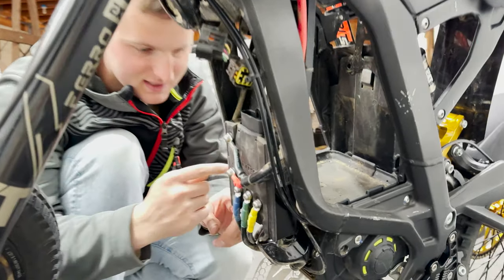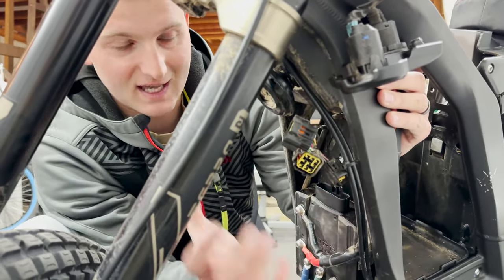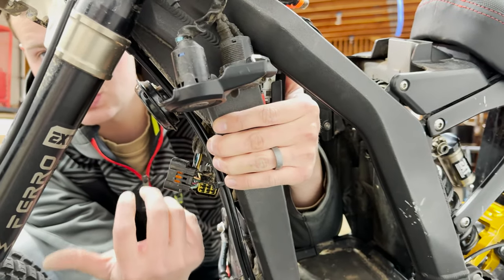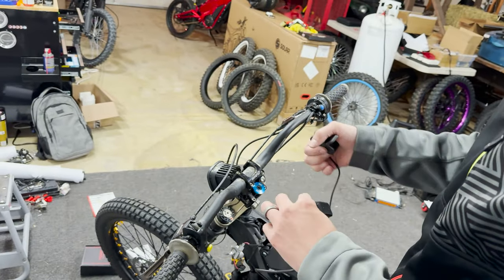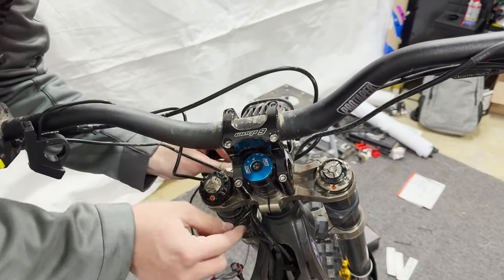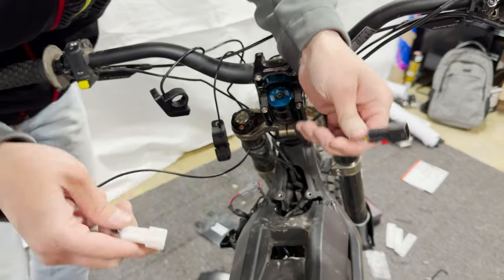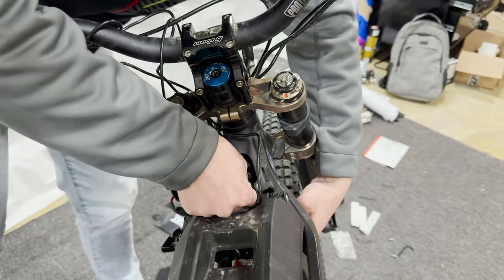We'll tuck the wires and tuck this guy on the side — these are your motor sensor wires coming down underneath. To remove the extra wire harness from the old controller, we had to move our breaker out of the way, but you wouldn't necessarily have to do that if you were removing a stock controller. While we have the top part opened up, we have quite a bit of room in here. We're going to route these wires through our fork here — that's our display wire and our regen wire — then fish them all the way down to plug into the controller harness below.